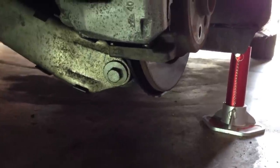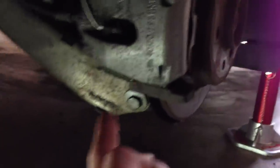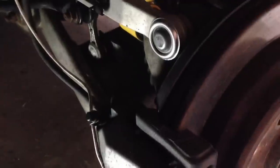The first step is to use 18mm and 24mm sockets. The 18mm goes right on here and the 24mm goes on this bolt right over here. Go ahead, torque them in opposite directions, and pull that bolt out of the control arm underneath here.